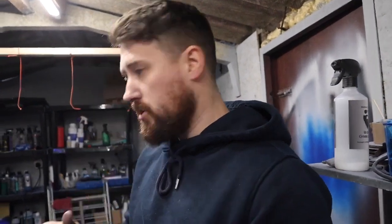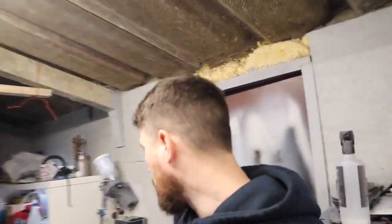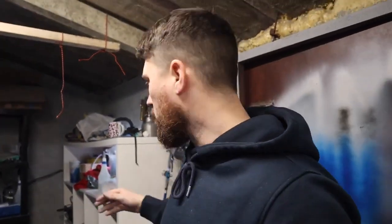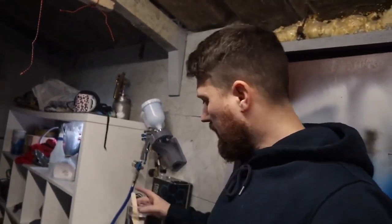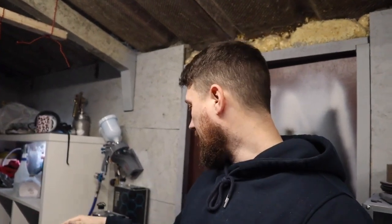So the base coat is laid down so much nicer this time — got a really, really nice finish. I've given it enough time to cure up, it's time to get the lacquer on. In terms of lacquer, this is what we're using — it's called the Final Systems. I'll put a link below to where I got all the paint for doing this project. That gets mixed up at a 2 to 1 ratio — it comes with the lacquer and the hardener. So you fill your lacquer up to the 2 mark and then you fill your hardener, thinners — reducer, whatever you want to call it — up to the 1. And then that's you got the correct mixing ratio for that specific clear coat.